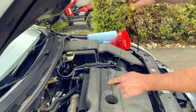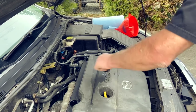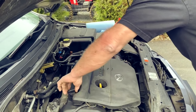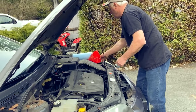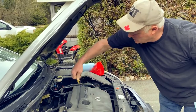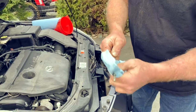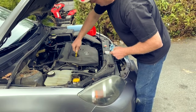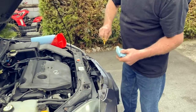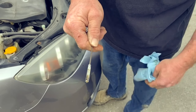We're going to put the stick back in now. The oil does take a little bit of time to drain down. We'll put the cap back on, use our piece of paper again, and see how much oil is inside. You always pull it out once, wipe it thoroughly, then put it back down inside. Now we pull it out and we can see we have oil on the stick — we're about halfway up. So we're fine to drive the car. Thank you for watching CD How To — stay tuned for the next video.